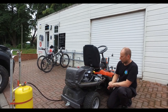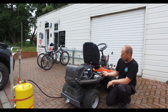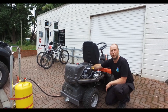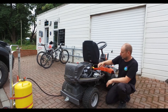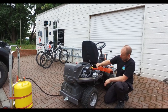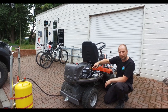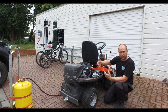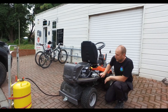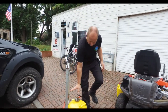It starts and runs fine. I actually managed to take the vacuum for the safety switch off the original fuel pump vacuum. So when the vacuum pulls, it releases the switch, which opens a safety valve that then allows the gas through. So if the engine stalls or whatever, it will just stop the gas supply — you're not going to have a random gas supply. Currently we have it on this cylinder temporarily.